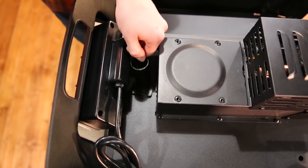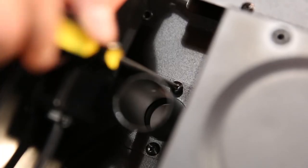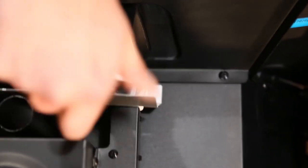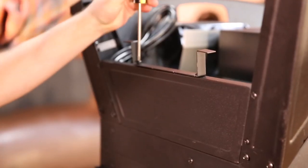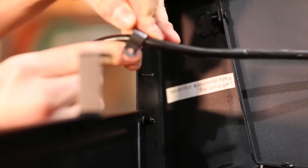Mount the grease exhaust tube to the bottom side of the cabinet. Then install the heat shield right next to it. Secure the cord bracket to the left side panel, and then run the cord through the clip bracket on the left leg.